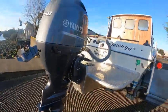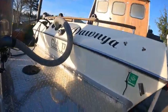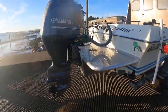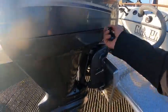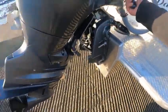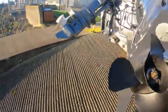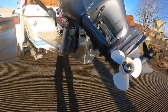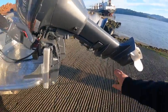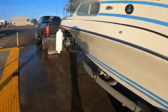We'll see if raising the motor definitely would have helped. This has got to be like an '89, '90 — 1990. Nice boat. Okay, we're gonna see what happens, but I can tell you right now you're not getting the water flow to that motor. When he's in the water, his water line is probably just right up underneath this, so that means this would be dragging just sitting, and then when you take off it'd probably be underwater. We'll see what happens. Boat Doctor out.